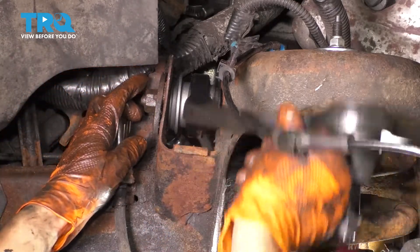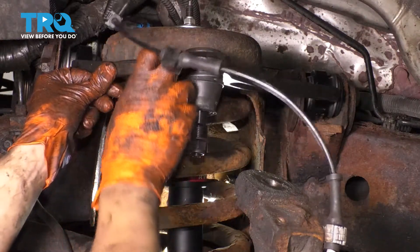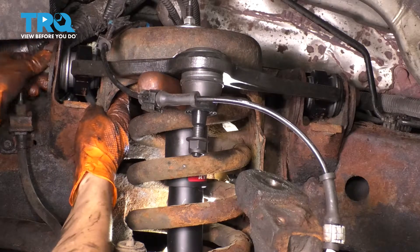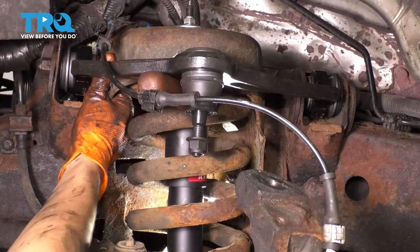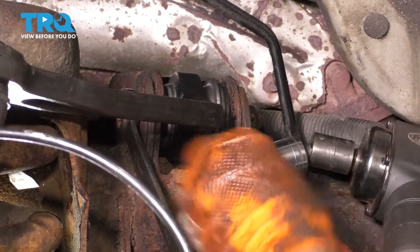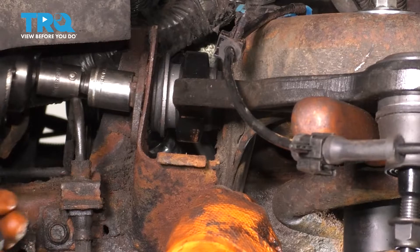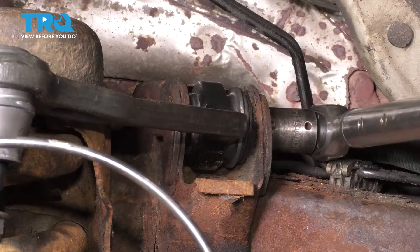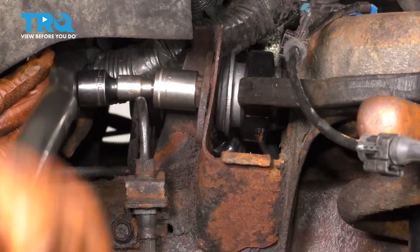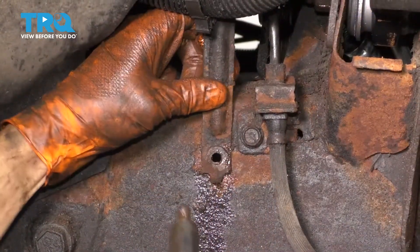This control arm has to be tightened with the control arm at ride height. The way you set it to ride height is right about here — I like to just put a pry bar through the spring to hold it there. Now we can torque the mounting hardware. Just eyeball the alignment to where it was before, then drive down to your local alignment shop and they'll take care of it. I'm going to start with the rearward bolt and then move to the front bolt. Torque them to 129 foot-pounds. I have to use a 3/8 socket for this one but that's the only way it'll fit. Now I'm going to reattach the bracket for the wiring harness.